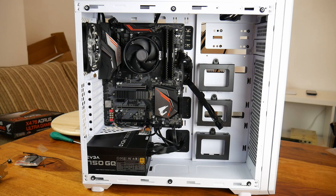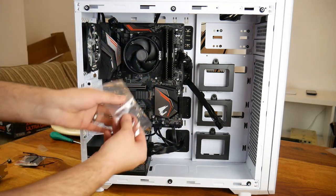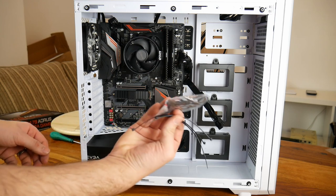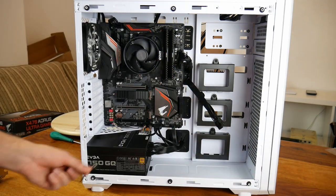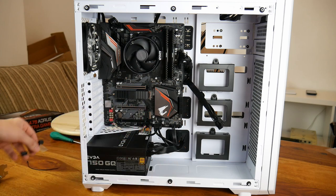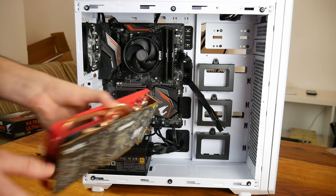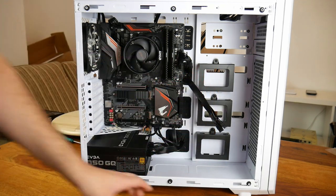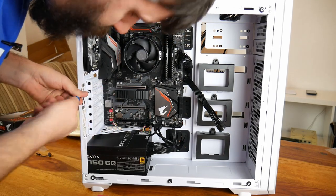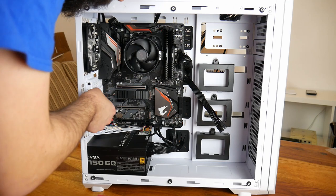I feel a bit of a plonker — first, I found out there IS a standoff supplied in the M.2 box, I discovered it whilst packing up. I've also found cable ties and some cloth for cleaning. There's also a speaker in the accessories. More importantly, I did not install the graphics card — so this is an older Radeon HD 7950. Let's slot this behind there and line it up in the top PCIe slot. It'll probably help if I opened the latch — and there, it's now clipped into place.